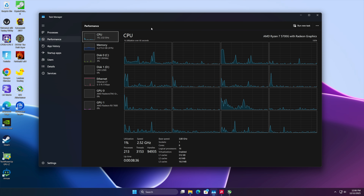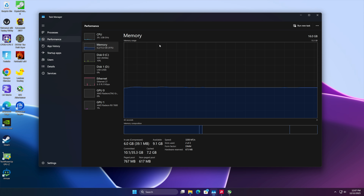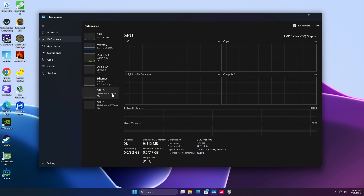We've been up and running for a little while — rebooted a few times getting all the new drivers installed, and so far it's been working pretty well. We've got that Ryzen 7 5700G: 8 cores, 16 threads — not the most powerful processor, but it should put down some decent performance. 16GB of RAM came pre-installed at 3200 MT/s. If you use aftermarket RAM, it'll default to 2400, so getting HP or Dell RAM that runs at 3200 should boost up to that. We've got the AMD Radeon onboard graphics with the 5700G, but we're using the Radeon RX 7600 with 8GB of VRAM.